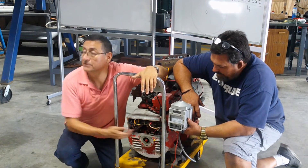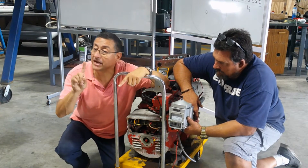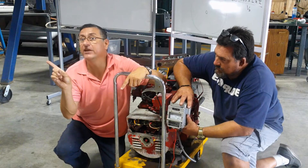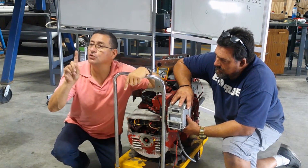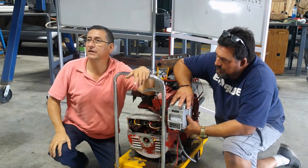I am going to check phase by phase. This element has a needle. On one end is zero, on the other end is one thousand millions of ohms, or infinite — too many ohms. If during the cranking the needle goes to infinite, it's a good indication. If during the cranking the needle goes to zero, it's out.